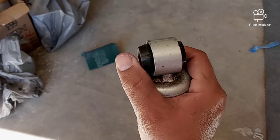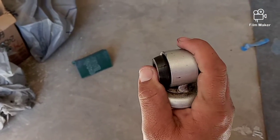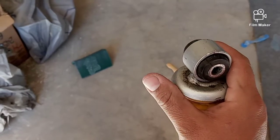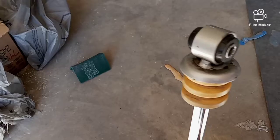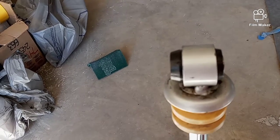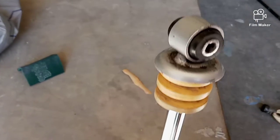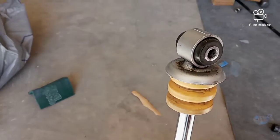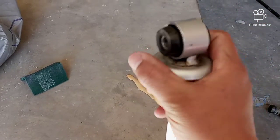New bushing in. I don't know why my video stopped and I had to restart it, but I apologize for that. New bushing in is now tight. We took a little more meat off the sleeve. I got to press it a little further. So this looks like it will be a fix. Big shout out to Patrick at Offroad. So we'll get this up in there and we should be good to go.